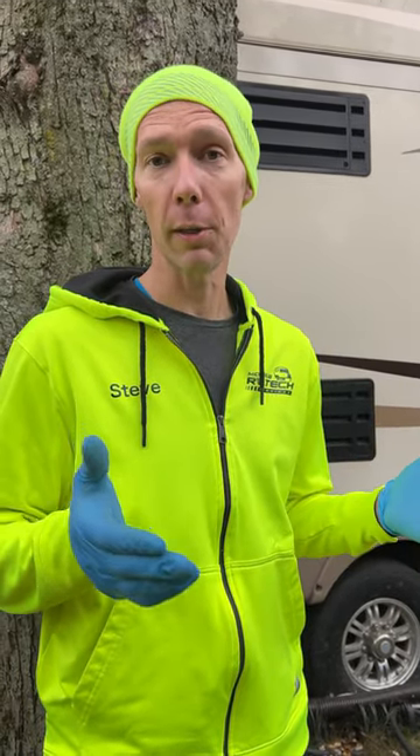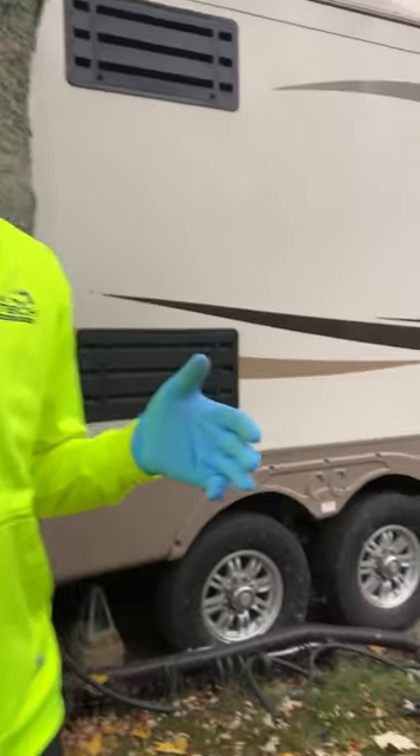If you're going to close your RV up for the year and you're trying to put the slide outs in and they won't go in and your lights start dimming, you have problems. Most likely it's a battery issue.